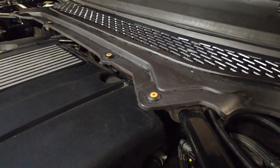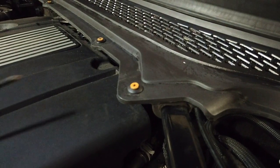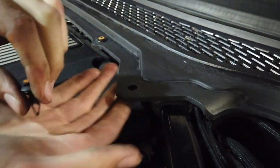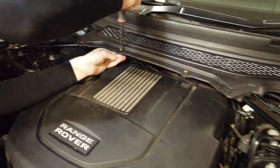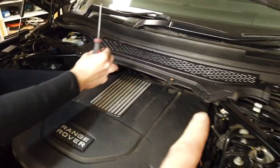By removing these little fixings you get more movement. They're rubbishy plastic ones — you unscrew them a bit but then squeeze from the bottom to help release them. What I did was squeeze these two sides together and unscrew, which keeps force on the threaded aspect and allows that bit to pop up. There are four of those along there.